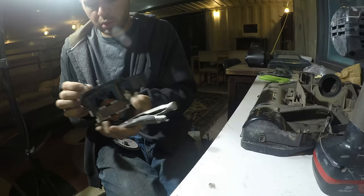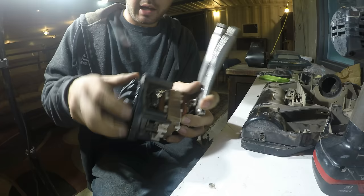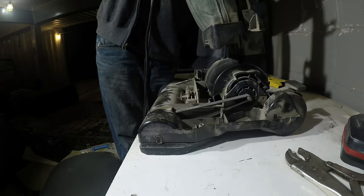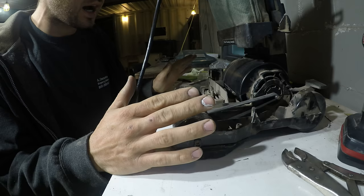All right, I figured out the issue. This washer here, do not leave out that washer. It goes right there. If that washer is not there, this fan motor tightens down and locks everything together. Now, look, that's all the way tight, and it spins. All right, that sounds pretty good. You know, it's not grinding, it's not shooting sparks out of it. I'm confident it's fixed this time.